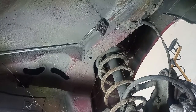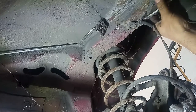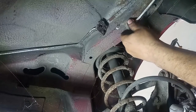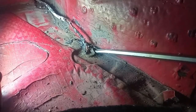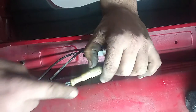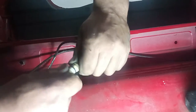That is very good. Now here on the ABS sensor, we have to remove it from the inside of the car, and also over here. Again, a large screwdriver, because it will not pinch onto the sensor or the cable. Okay, now on the inside. Just like on the front, we have here the connector. These ones, because they are on the inside of the car, normally they do not crack as much, but this one is already very bad. Let's see. Yeah, comes off much easier.